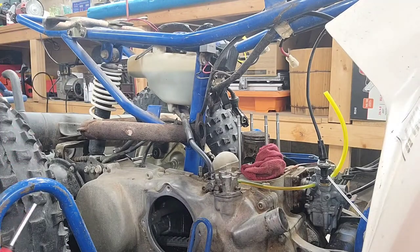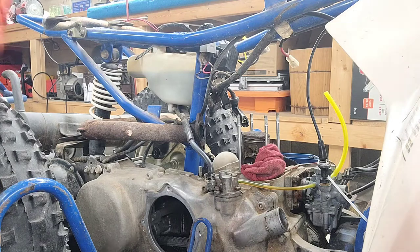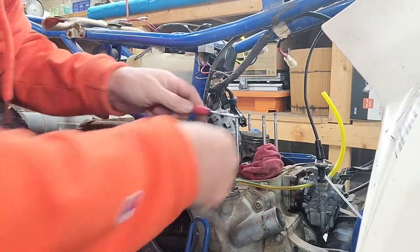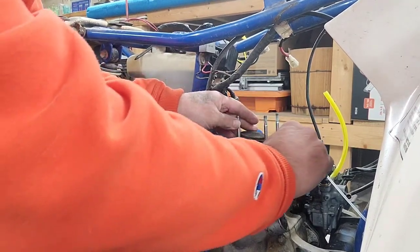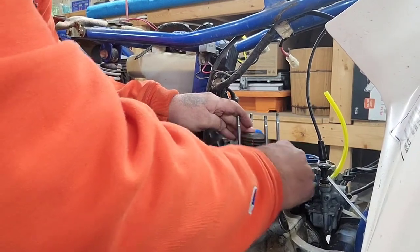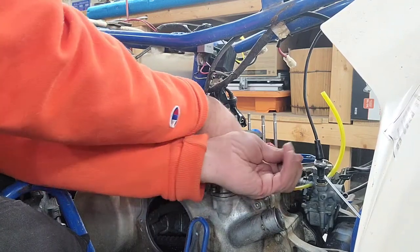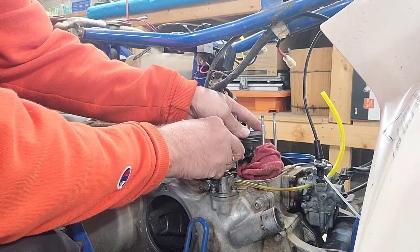It's the next day — I had some snowfall so I had to go take care of that. But I'm gonna go ahead and get these little clips out of here. Just take a small flat head, there's a little notch right there, so you're just going behind that little notch. Put a rag down in there so you don't lose it — so it doesn't fall down in there rather. Just kind of work your way in there with two hands, and there it went. Let me just push your pin out.